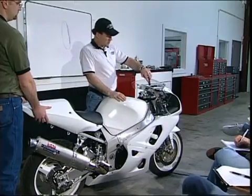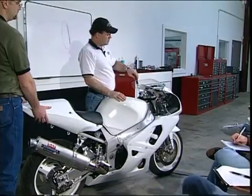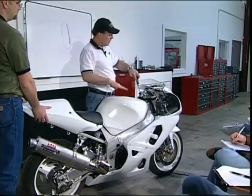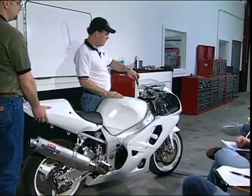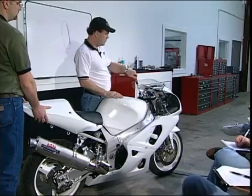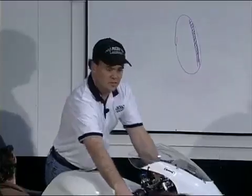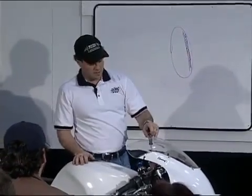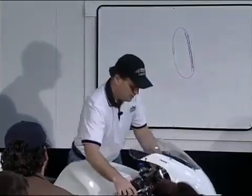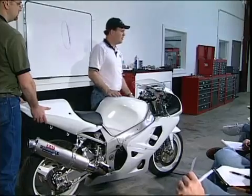Let me show you. If you set it to where it rebounds just as quickly as possible and doesn't settle at all, I found that's almost too tight usually, and it's not where I recommend starting. I like them to just settle just a hair, right? So kind of something just like that maybe. And this almost feels slow to me right now, and it's kind of a little chilly in the warehouse. If it was me, I might back this baby out a little more, right, before I sent this person out. Just like that, right? We want a nice quick return, very light settle, if anything.